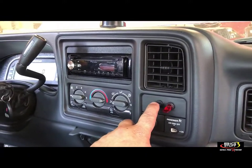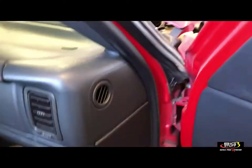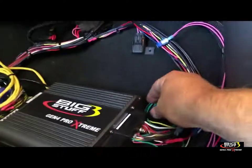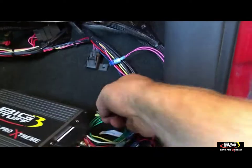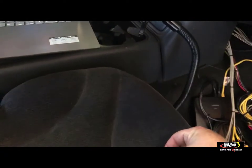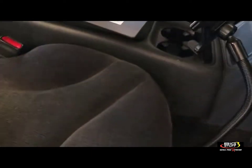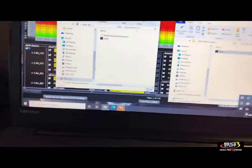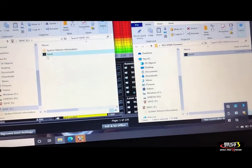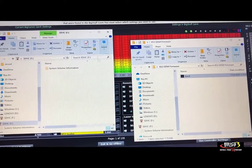Now we're going to turn off Y2, then turn off the ignition — no more ignition switch. Come back and grab the SD card. We need to get that firmware file off of it and delete it. Put the SD card adapter back in the computer — the software already sees something is going on. Select the firmware update file and delete it. You want this card to be nice and empty with nothing on it.